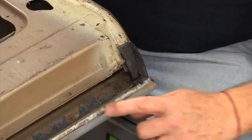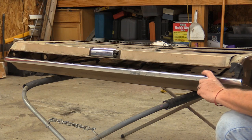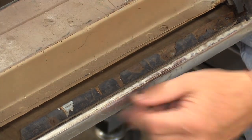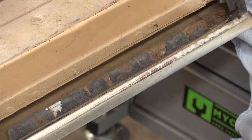Another problem area on your wagon is this channel right here. This is your outer beltline weatherstrip on the 69 Fairlane wagon. It is a particular piece - you cannot substitute anything else because the actual weatherstrip bends into an L-shape and then the white portion is actually straight out off of this bead here. It doesn't curve down and in. It's straight and flat, and when the glass comes up it pulls it into an upward position causing the water to cascade to the ends and drain down into your tailgate and then it rusts out. That's why most of your wagon gates look like they do.